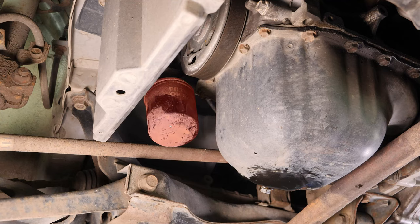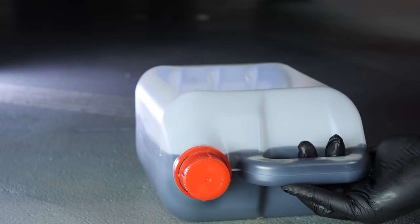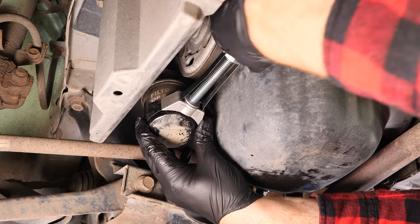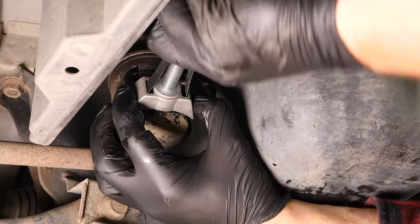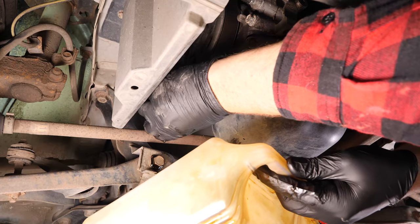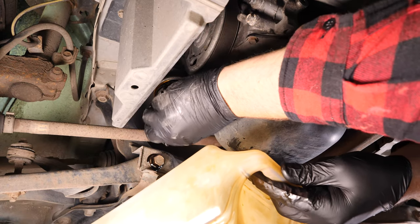When performing an oil change, it is necessary to replace the oil filter. Access to the oil filter is done from underneath the engine compartment. To avoid letting the oil inside the filter from flowing out, place a liquid collector under it. Loosen the oil filter — if you are unable to do this by hand, you can release it with an oil filter wrench. If the filter remains stuck, watch our video on unscrewing a blocked oil filter. Remove the oil filter, and when released, turn it upwards to avoid spilling any oil.